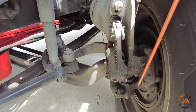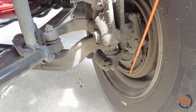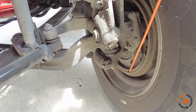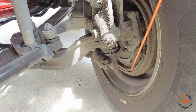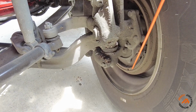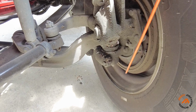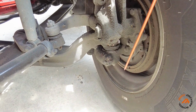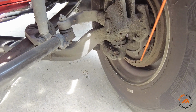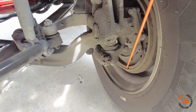Down here, we're going to find the brake shoes or lining. Not damaged, properly mounted, no less than 1/4 of an inch. We're going to check the brake drum. Securely mounted, not bent, no illegal weld, and not damaged. In between, no debris.